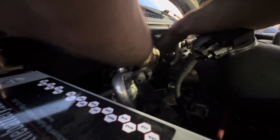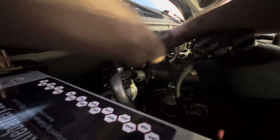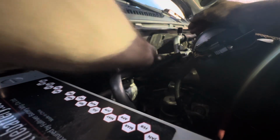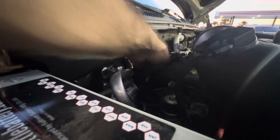I'm going to need to leave the radiator cap loose so it doesn't build a bunch of pressure inside, because the thing was fine for 10-15 miles or whatever, and then once it built pressure, the thing let go at a red light, and then the low coolant warning indicator became illuminated on my Escalade dash cluster, and well, you all know the rest of the story. Here we are. So I don't expect this to last very long. I just hope it lasts long enough to limp this truck back to the house, and then maybe one more time back to the shop afterwards. We'll see what happens here.